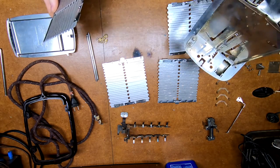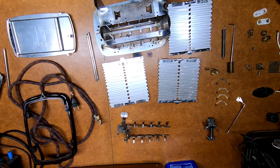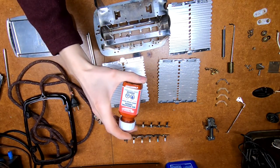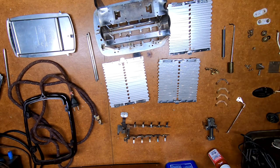Once I've got these ready, I think I will make it extra special safe and throw on a little bit of insulating varnish. This stuff's good for like a thousand volts - I put it in a starter motor. That is the plan. Interestingly, only the outer two elements actually have these little fingers; the inner ones don't.